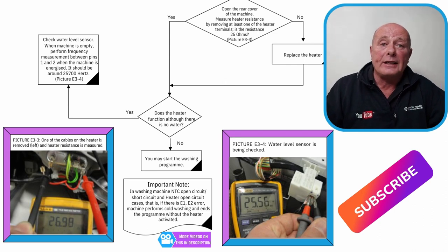If the machine is heating and there is no water in the machine, then you may have a problem with the pressure switch. There is another video to help you with this — you will find it either in the description below, or in the main video showing all the error codes, which will have a link to the pressure switch test.